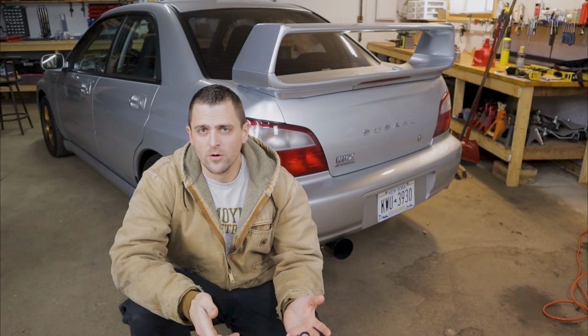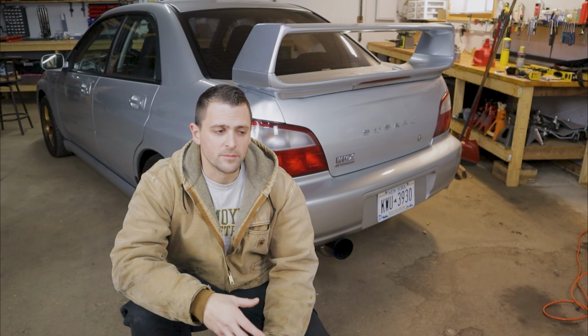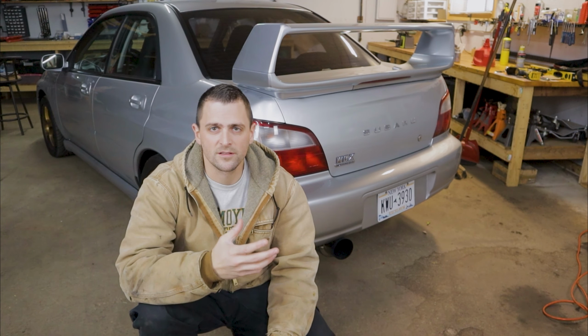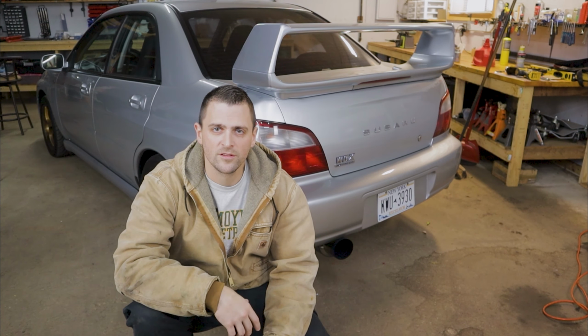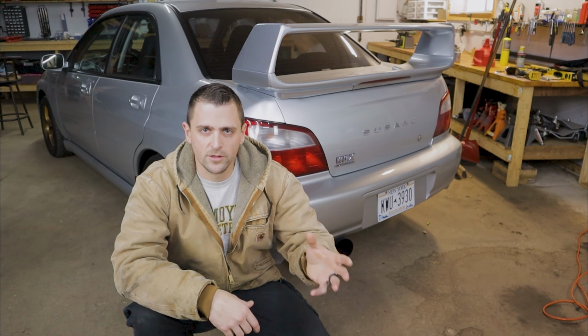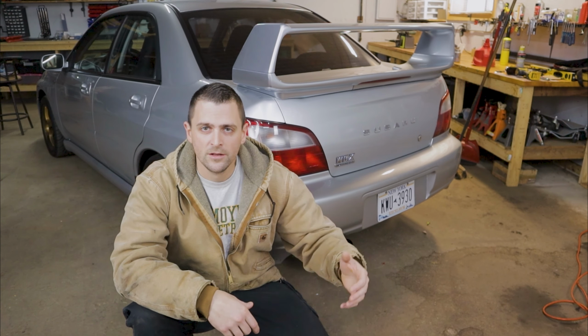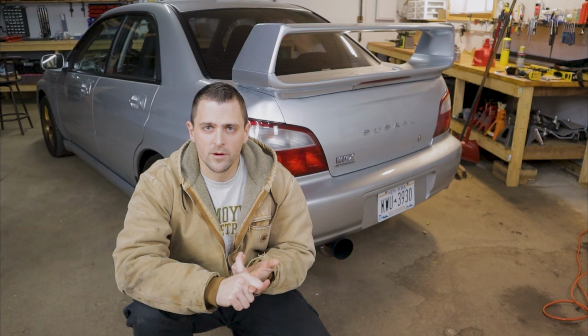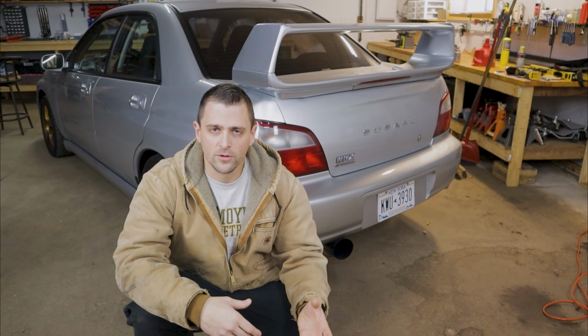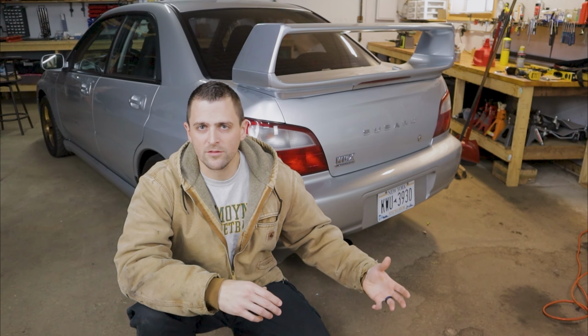Saying that, I realize that might be oversimplifying the process a little bit. It can be a relatively tedious and time-consuming process to get the fuel tank dropped out of one of these cars. But I wanted to make this video and post this just to show you that there is a little bit of an easier way than typically what you're going to find people recommending you do. Doing it this way, you don't have to worry about disconnecting your lateral links, which would involve an alignment once you're all done with it. You don't have to drop the drive shaft. You don't have to pull down the rear diff. There's a whole lot of disassembly that you can avoid by doing it this way.